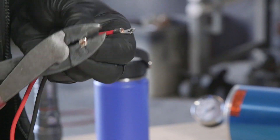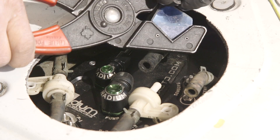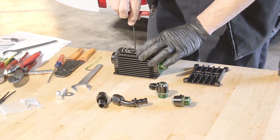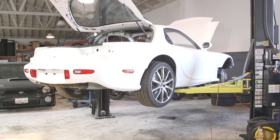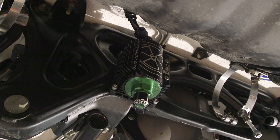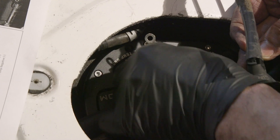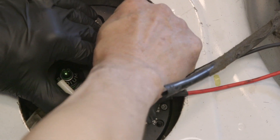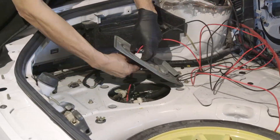Next, measure, cut the length, and terminate the wires for the fuel pump and lift pump wire harness. Slip the OEM dust plug over the harness. We are using the stock return line but a larger feed line. Our return line was simply installed onto the fitting on the top plate. Our Radium fuel filter was assembled and readied for installation. A larger fuel feed hose was measured from the top plate to the filter and the fittings installed. We installed our fuel filter to the cross member, but had to move the car's accu-sump out of the way to fit it — once installed, the fuel filter can be serviced without removing the accu-sump. Now our fuel feed line can be installed to the top plate. The wire harness is also installed onto the top plate, and once the ring terminals are bolted down, put nylon terminal covers over all the ends to prevent any chance of a short circuit. Thread the wire harness through the pump cover and put the dust plug in place, reinstalling the pump cover.